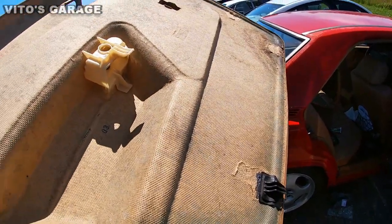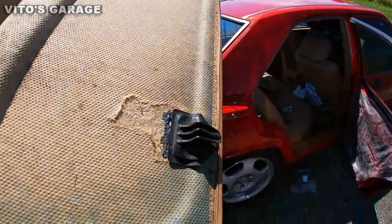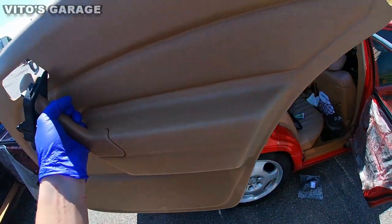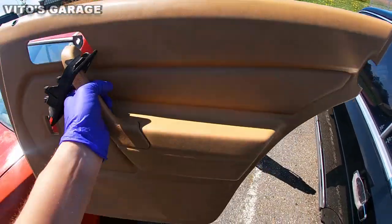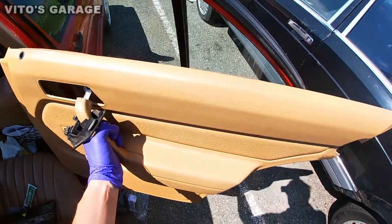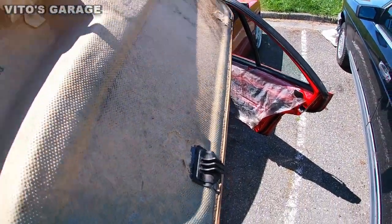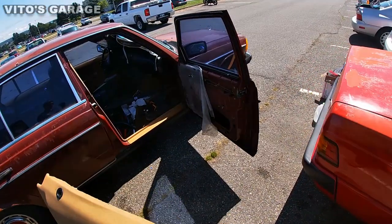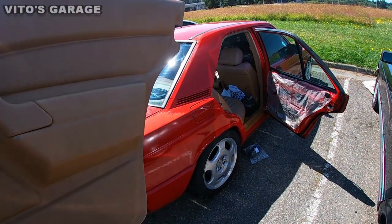The previous owner didn't know how to remove the door panel on this 190E and broke off three of the hooks — he already tried to glue one back, and it's holding up. It's really sad when people start working on these cars and don't know how to do it. He just removed a couple of screws and tried to pull the panel, but W124s and W201s have hooks — you have to lift the panel off. With W123s you pull, but with other Mercedes you need to know the procedures and look up the factory repair manual.